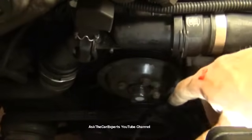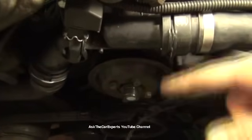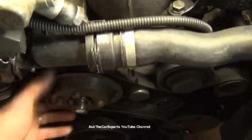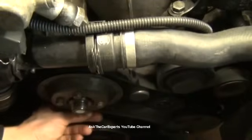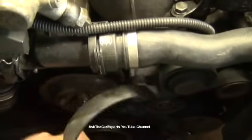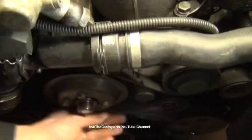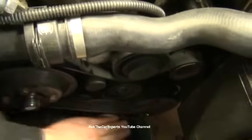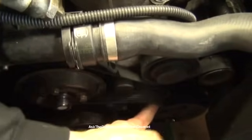Well, these are going to walk off if they're not tightened up. So make sure, next step is to get that belt on, there's my light again, and then tighten these up. Now the good news is my belt didn't go too far, so it was just hanging off to the side. Just wrapped it around the pulley first, like this. Make sure that all the contacts are good down the bottom and at the crank, or else you won't be able to tension this right.